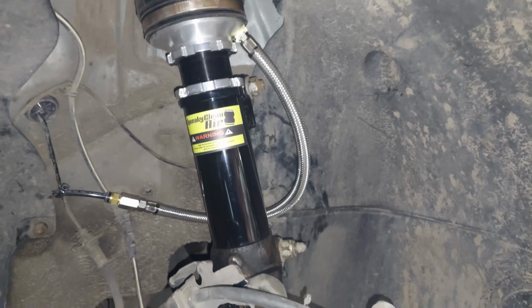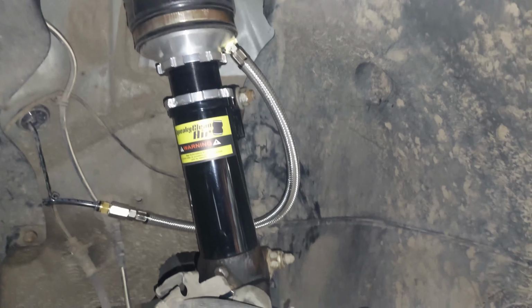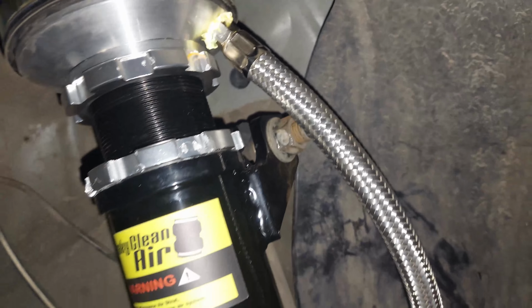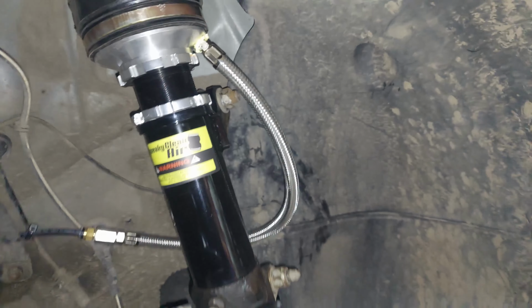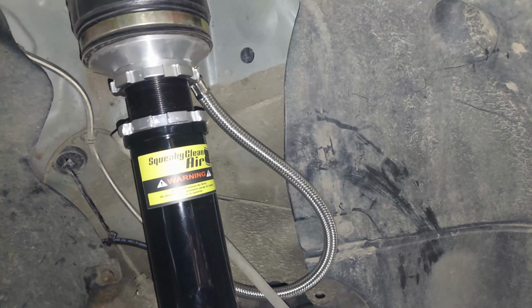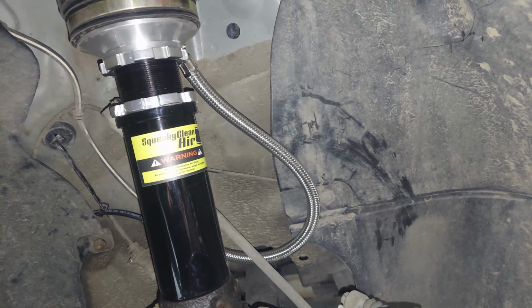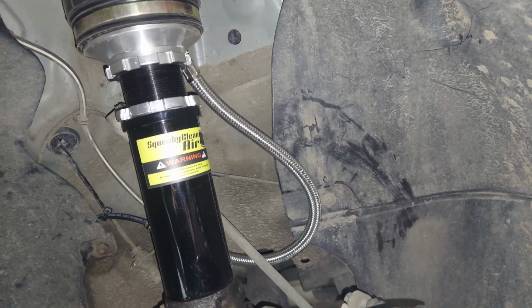And what I'm doing is, while the car is running, I'm able to move back and forth to see how the suspension is going to work, whether anything is going to get bound, whether the end links, anything like that, are going to get bound or not. So if you could turn to the left, please, that way it gives you an idea how things are going to work when the person is driving. It's different when you just slap it all together, whereas you can actually simulate it right on the lift.